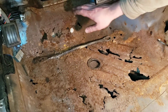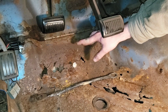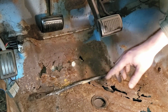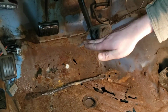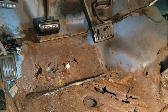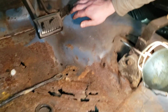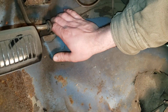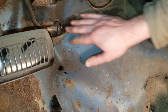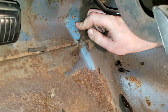So try to preserve that as much as possible. What I'm gonna do is actually cut all the metal right there and use a little Dremel and just make little notches in it and kind of peel around those spot welds and break them, so we don't actually twist that flange around at all. And then again, be careful how high you cut here, because if you cut too high, higher than your replacement pan goes, you're gonna have to find a way to fill it or do something. So that seam runs all the way, you can see underneath all of that.